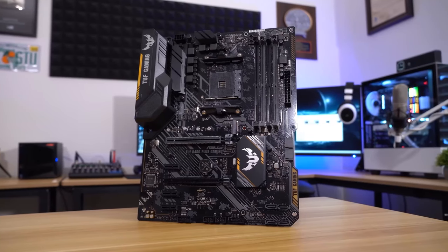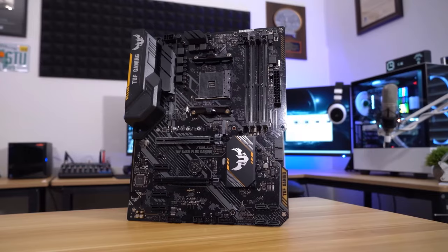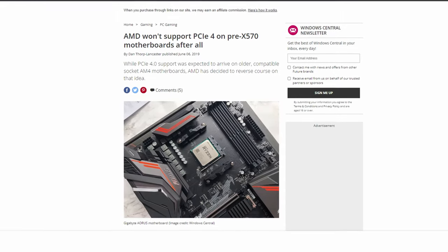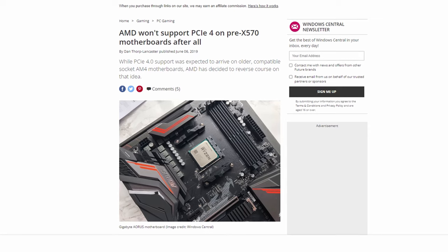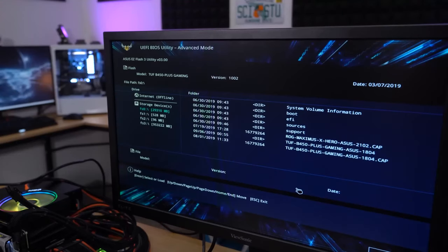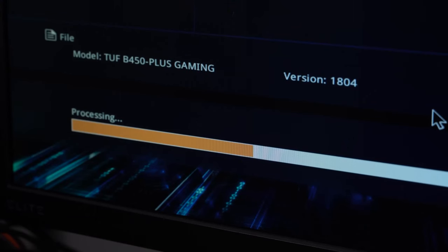In beta versions of firmware for the 400 series boards, PCIe 4.0 support was enabled if a processor with a similar bus was installed. However, this feature did not live to see the release, so even with Ryzen 3000 and 5000, the 400 series boards will work only through PCIe 3.0. Fortunately, modders have learned to return the cut-down functionality for the up-to-date BIOS, but the fact is this: now updating BIOS without any reason is not something that you should do.